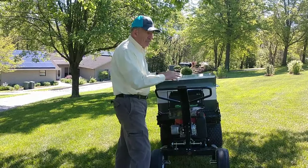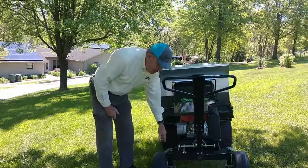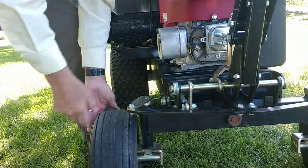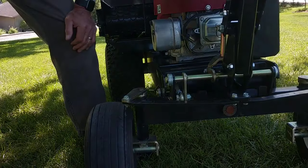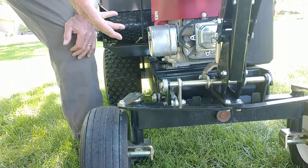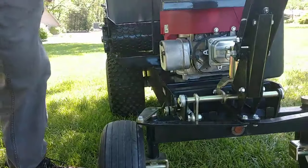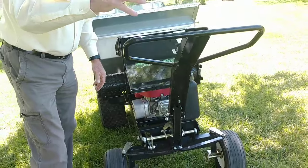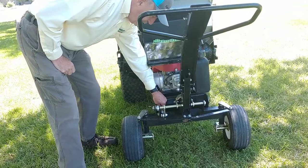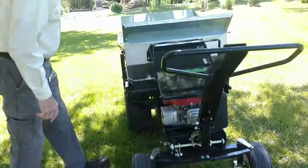It does have a stop system built into it. When it hits that stop — which is set at about 15 to 17 degrees — that's what's recommended so that the engine oil and transmission don't lose lubrication from too steep an angle. That stop brings it back to neutral, and if that doesn't function right, there's a simple adjustment device right here that you can tighten or loosen to make sure it goes into neutral.